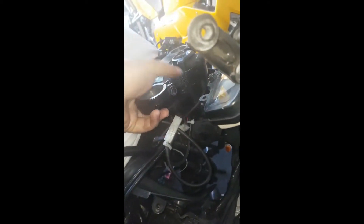Now that the forks and everything are removed, this is notchy as hell. So notchy, you can barely move that. That bearing has collapsed. This is on the ground, raised up with the forks and wheel on — not a thing. That lower bearing is rooted.